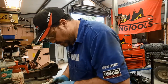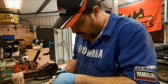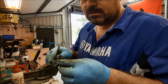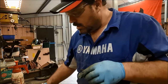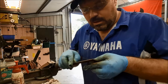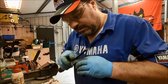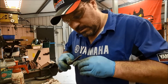Okay. So, pads. That's the pad that goes against the pistons. At the other end of the pads, well, one end we've got the pin that retains the pad. And this end of the brake pad fits into a spring clip down the bottom. Again, there's usually a lot of corrosion on there. What's a good idea is, only where it makes contact, just clean off those flats. Again, a file's a great idea because it makes sure that the whole thing stays flat rather than sandpaper.